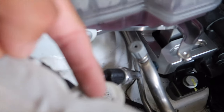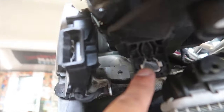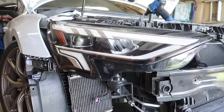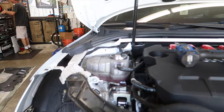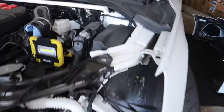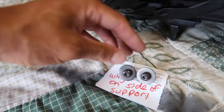There's a T30 screw right here, one right here, one right here T30, and then one underneath — T30. You can see the safety connector here and it connects right here as well, with a spot for the wire to sit. Headlights are out — looking like a whole Skeletor over here. We just took out these two T30s, which are attached unlike on my old Golf. We've got these little short T30s on this side making notes — I like it.